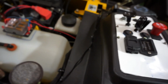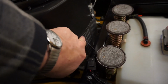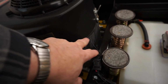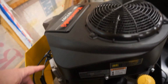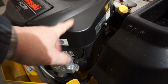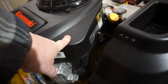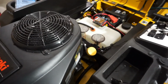This is going to come around the back of the fender, over to the side, then it enters the engine through a drain port right here in the aluminum block, goes over here and goes down and around, back up over to the spark plug wire right here, and inside the engine cover it goes around the spark plug wire, I think 10 or 12 times, and it's secured with 3 small wire ties.